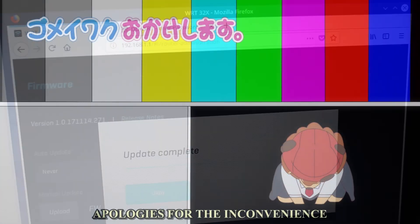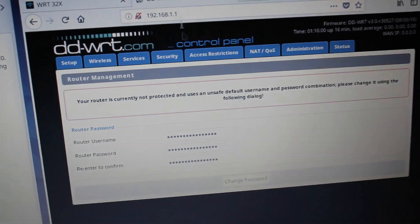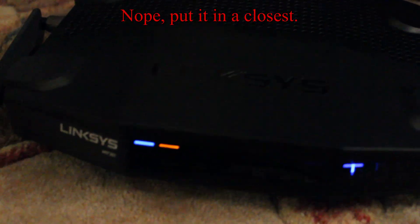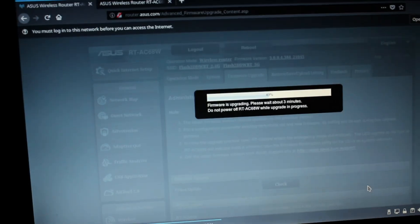Just got out of the shower. Go ahead and reload the page and then you'll see this — so it's that easy. Enjoy, and remember you can get it on eBay at a real low price. All I did was go to the DD-WRT website, grab the file for this particular router, and do the firmware upgrade — there's a little button that says upload right below. You pick the file and start it, and as you can see it's working. With this router I didn't have to do anything different, so far so good.